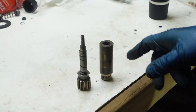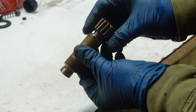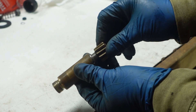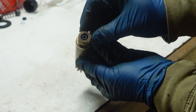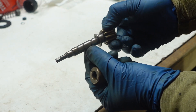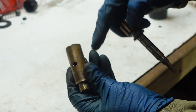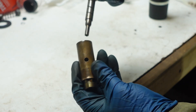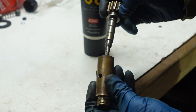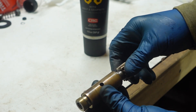So this is the drive gear for the tachometer. This fits in like that, and then this gear interacts with that smaller gear I showed you on the distributor drive gear. And here's where the cable would screw in. I just took it apart and cleaned it up. You notice there are grooves cut in this, so it does provide some lubrication. This little hole right here is where a little set screw goes in. So I'm going to apply my assembly lube to this and get this guy in — that'll be essentially the last thing prior to doing the distributor itself.